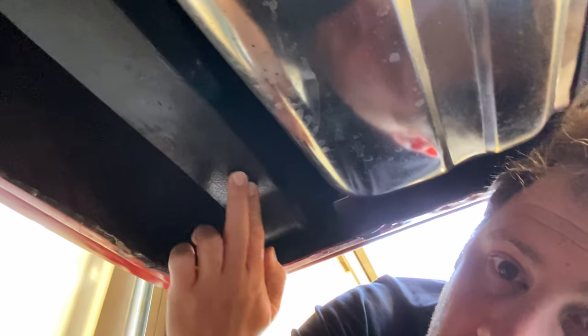I've got the original mono leaf springs on my 67 Camaro — you see them right here. I want to keep those on there; I don't want to switch them for coils. I like having the car in the vein of original. But we're going to add the traction bars to solve the wheel hop problem. What they did to solve it back in the day was in 1968, they staggered the shocks and made the mono leafs into dual leafs. Here we are with my original single leafs, and we're going to see how the car drives once we get the traction bars on.